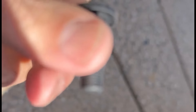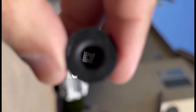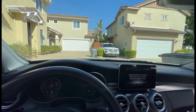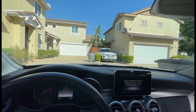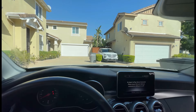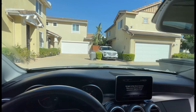I cleaned this thing up — washed it very nicely. It was all clogged but now you can see through it clearly and it's all clean. Let's put it back in and see if it works. I cleaned the little rubber filter, put everything back, turned my car on, and let's see if the wipers work. If it works, my effort is all paid off, but if not I'll need to check something else.